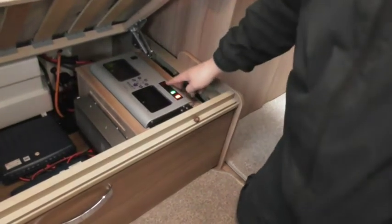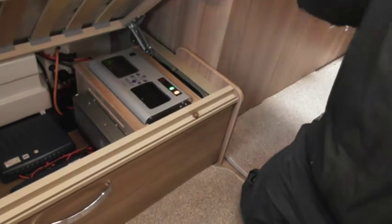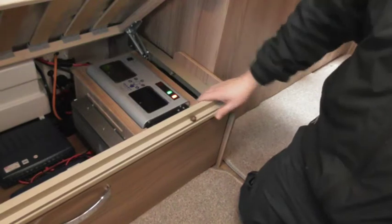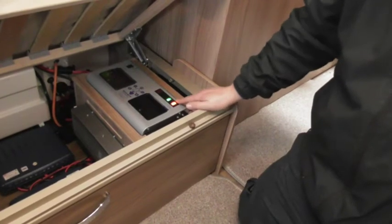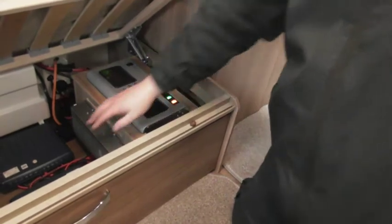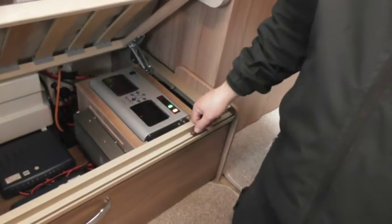We've then got reverse polarity, so if you do ever go abroad, that will light up to let you know foreigners are backwards, because their power's the other way around to ours. So if that's ever lit up, that's letting you know there's a problem with the power externally. Then battery charger, heating and hot water. We'll just leave them two on, because they're only ever live when you're plugged into the mains. And when you're plugged into the mains, A, you want your battery charger recharging up your batteries, and B, you want your heating and hot water running on mains. It'll always be on the mains.